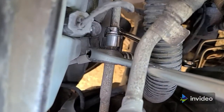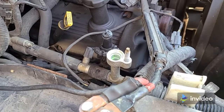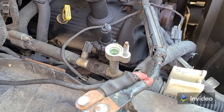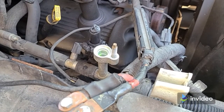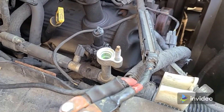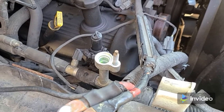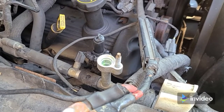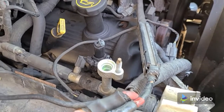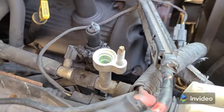That's what it looks like installed. I leak-checked this truck with dry nitrogen and it's pretty tight compared to before. This truck had a leaking rear AC line that looks like it's been fixed once or maybe twice before — it's got some rubber hoses with hose clamps, so it's not a pro job. Something back there was leaking like crazy, so the owner decided to give up and block it off.